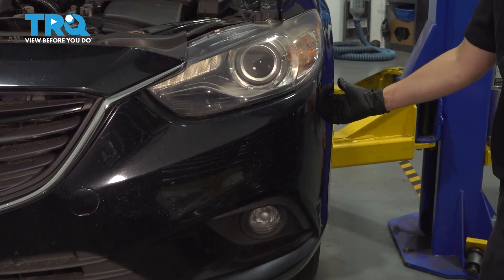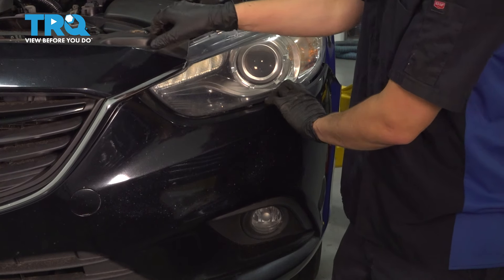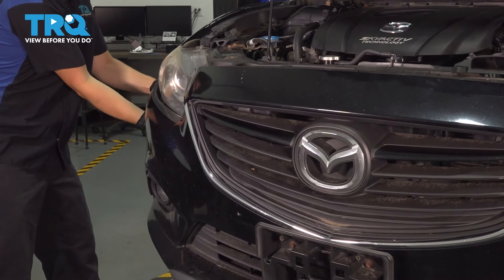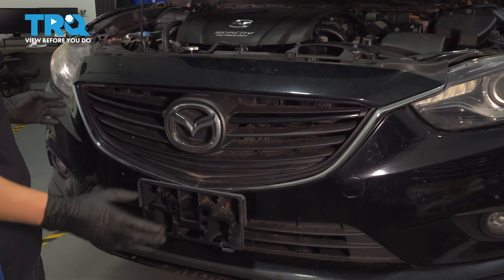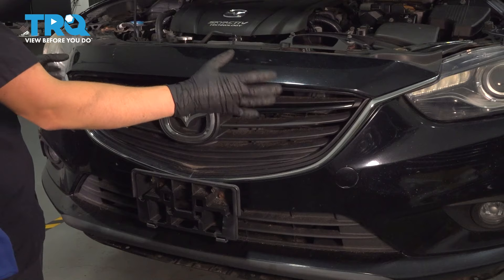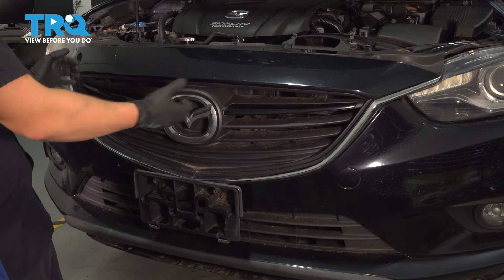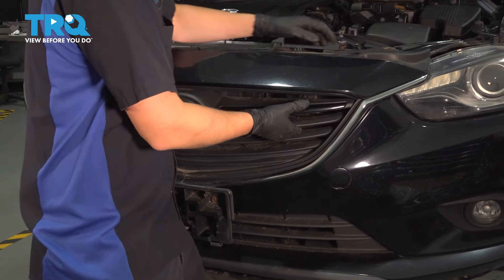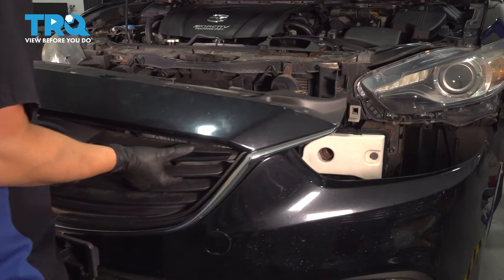Reaching in from behind the corners, pop the front bumper off of the fender — it's got a bunch of clips. Follow it along at the top here and do the same on the other side. At this point all of the hardware is off, so we are left with just two big alignment pins here and here. They go into the body of the vehicle and they're sort of like push clips at the same time, so you have to grab and pull firmly. Now you can remove your bumper cover.